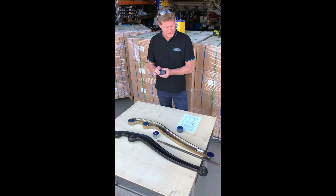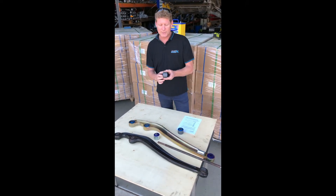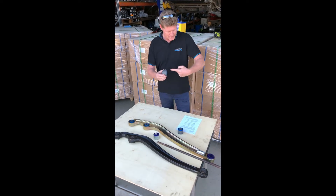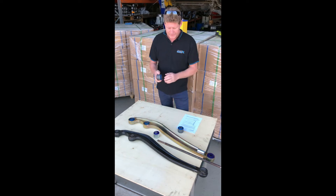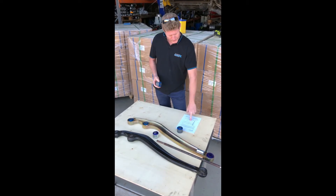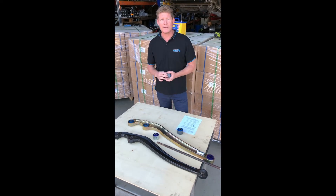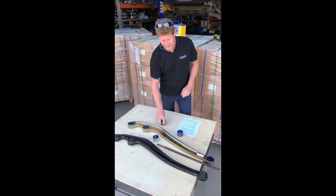Radial stiffness translates to noise, vibration, and impact hardness. Axial stiffness — that's this way — relates to vehicle tracking, and they're increased in axial stiffness. Conical stiffness is lower by a factor of two.